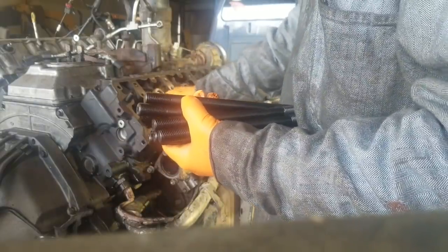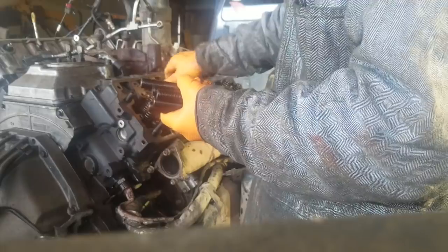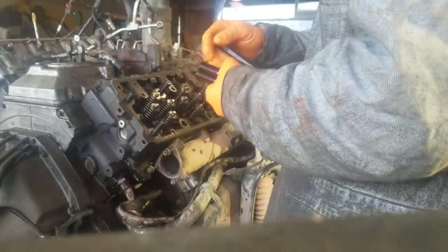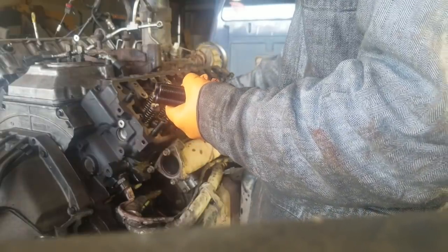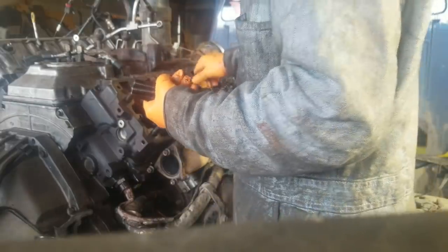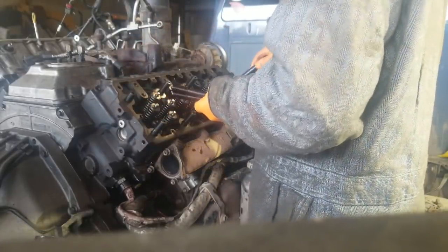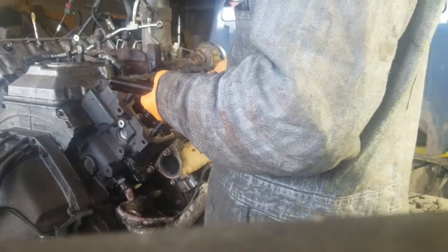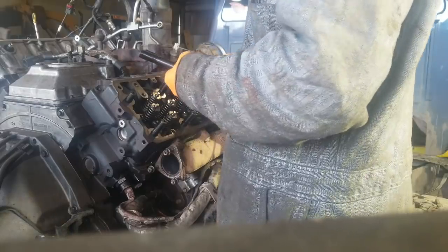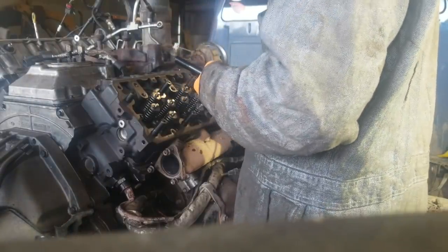I generally do that on these newer engines, these 6.4s and 6.0s, and even the old 7.3s. But if you work on multiple diesel engines, like I used to work on a lot of older Cummins, 290 Cummins, 220 Cummins, 300 Cummins, 444s, all those big cam motors, basically all those 855 blocks, even the N14s, they were all the same. Those three-piece heads, if they had 800,000, a million miles on them, and you had to in-frame them, you'd pull your head bolts out, and you would have to take thread chasers and clean your cylinder block threads out. For one thing, when you put that head bolt back in there and that hole's all rusty, not only do you take the chance of screwing up the threads on a brand new head bolt, but you're also taking the chance of not getting a true torque on that cylinder head. So make sure your threads are clean in your block.